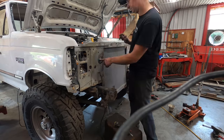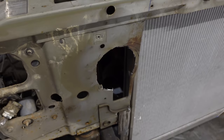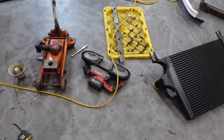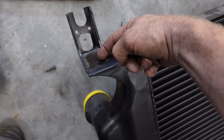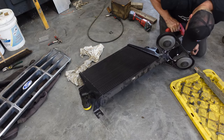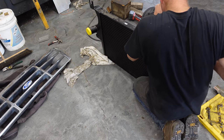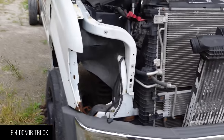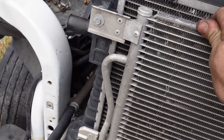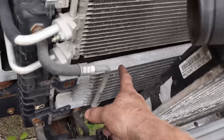What makes the most sense is to cut straight up and then continue the angle iron and stick it underneath this bracket — that'll give it more rigidity. We want it nice and strong here because the intercooler is going right up underneath. The issue is the bracket goes right to the end and we need it to sit right about here, so we'll just cut those off and call Vince to weld them back on in the proper spot. We've got a nice AC condenser — the top line's a little smooshed but we'll open that up; the rest of the tubes are okay. And we've got a nice big transmission cooler.